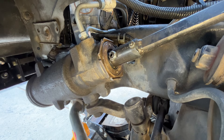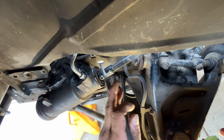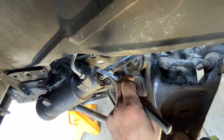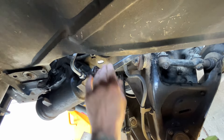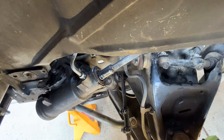I'm going to show you a much easier way to do this. If yours is old like mine and you're just trying to get rid of a little bit of that slop, here's really all you need to do. Just loosen that lock nut with your punch, then put your punch in one of those dimples and just kind of tap on it — get that thing to turn a little bit until it feels like there's no more slop in your input shaft. It wouldn't take very much, you just got to cinch that down, because sometimes those worm gears get a little worn out. You don't want to over-tighten it because you don't want it to be too stiff — that's going to cause a lot more problems with your power steering pump. So you want to just tighten up to where there's no slop in there.